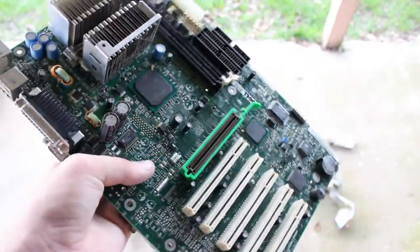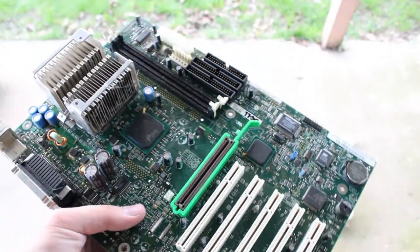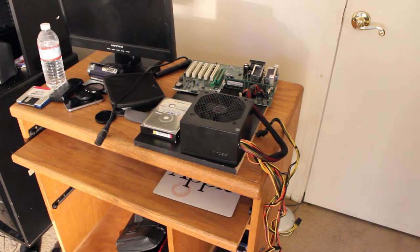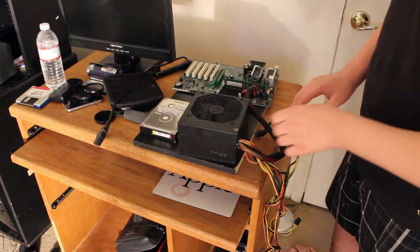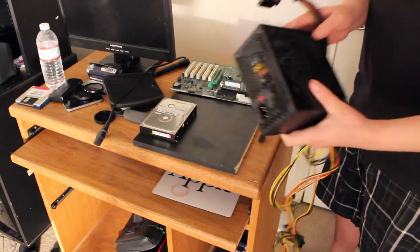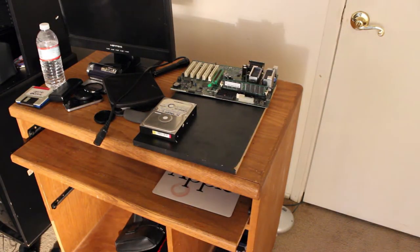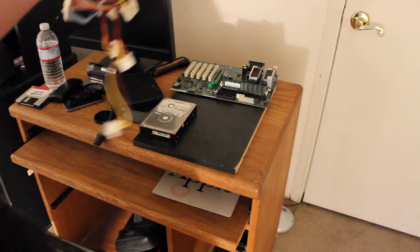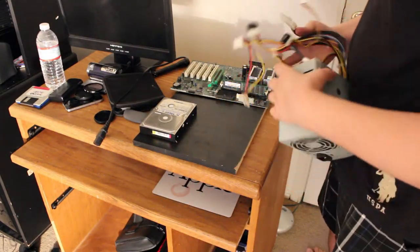I would like to do some bench testing on this thing and just see if I can get it to post. I've got my ghetto test bench here. The motherboard is hooked up. I'm probably not going to use the 450 watt power supply. I'm going to take the 450 watt out and use this super dirty, dingy 200 watt Dell power supply. What I read is that you have to use their 200 watt power supply with this motherboard.